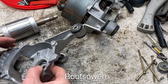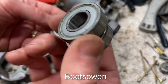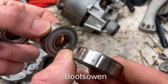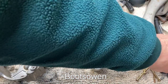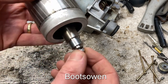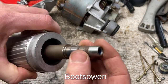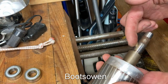A few days have passed and the post has been. I got these 6202Zs made by NTN — they were the cheapest ones I could get that were branded. They've got a tiny bit of surface rust on them and stuff. I've never seen the coating written on the outside, but there you go. C3 — I don't know if that's the one I want, actually. Compared to the old ones, they're a dream. I've got to figure out now how to get these onto the shaft. A tiny smear of just any old grease — tiniest little bit just to help these bearings ease on.